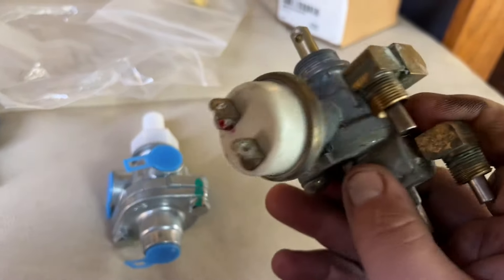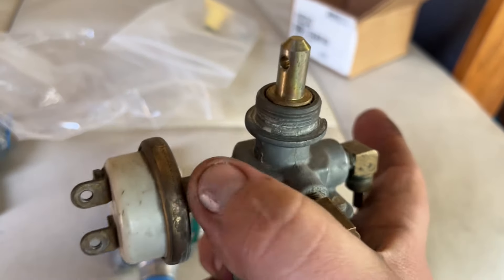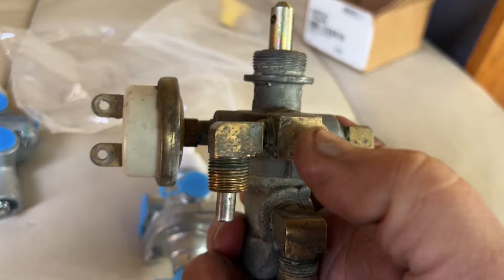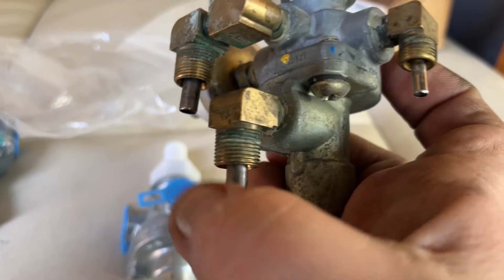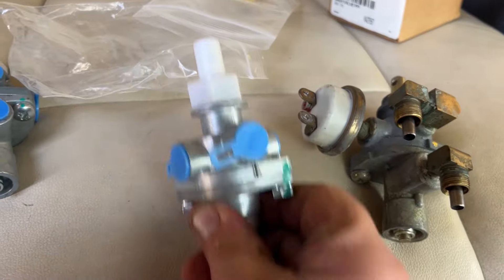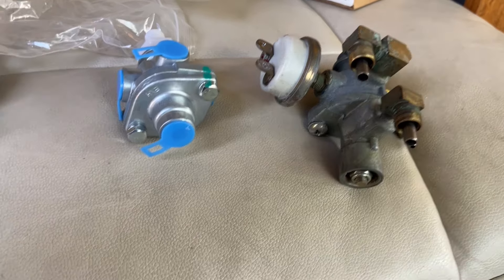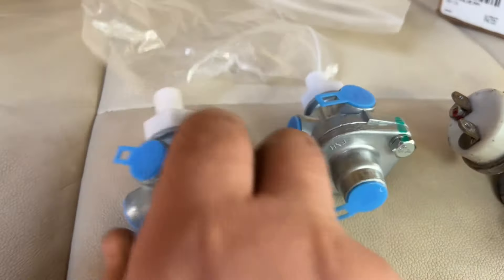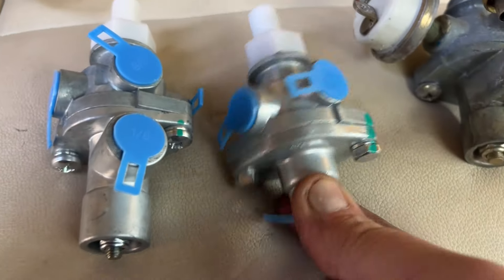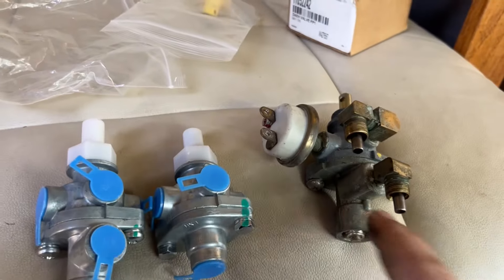This bus has a PP2 valve on it. The top half is the same — supply and two deliveries, one going to the parking brake can and one to a gauge. The exhaust is still on the bottom, but the bottom half has an extra delivery port that delivers in a different stage. The PP1 is used for spring brakes and the PP2 is used for DD3s. This bus has spring brakes, but somebody originally had DD3s from the factory and converted to springs, and when they did that they kept using the PP2. So we had to order a new PP2 valve with that extra chamber delivery port. The top halves are exactly the same — it's just the bottom part that's different — but it won't work the way they have it hooked up, so we have to stick with the original PP2 valve.